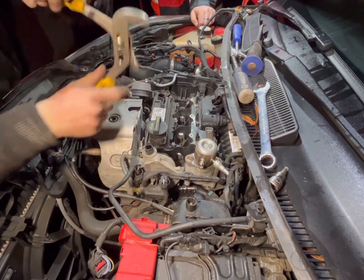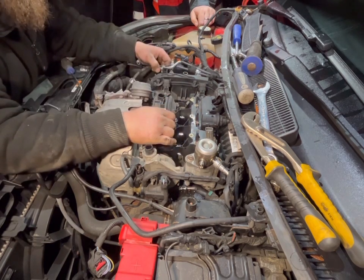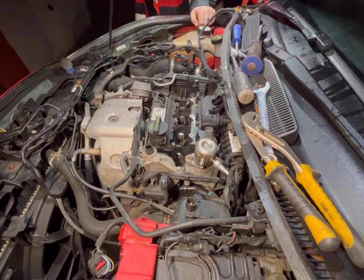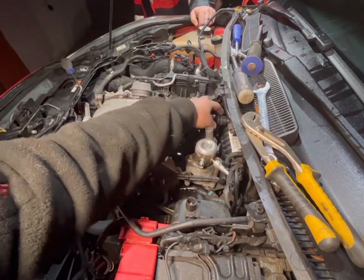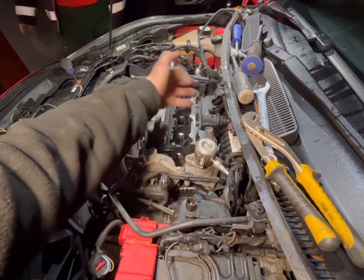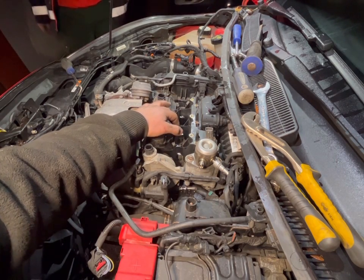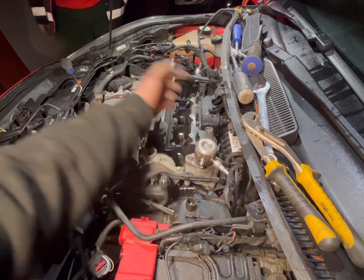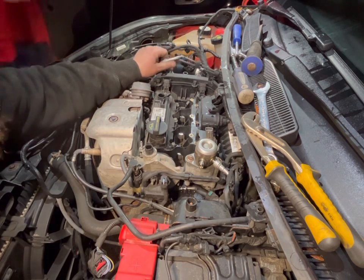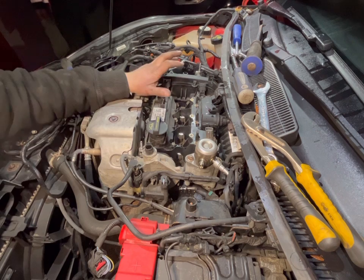Right. So, anyway, I'm cracking on without saying anything, and that's what I'm used to doing. But, yeah. So, we're at the point where the rocker cover is nearly off. There's a pipe here, and you can't see it. Let me just see what you guys can see. So this pipe here, you need to squeeze it together and push it back out the way. Anyway, you get that pipe off, push that to the back. These two. Is it some sort of oil breather? It is a breather. That's exactly what it is, mate. Right, I'm going in. These two back lines, push them out of the way, and then unbolt all the rocker cover bolts, and then it should come out.